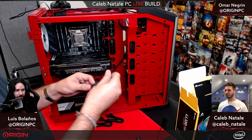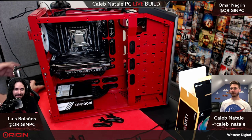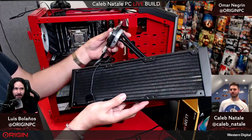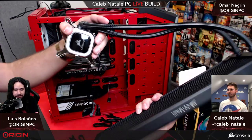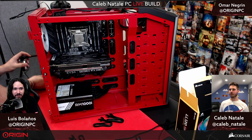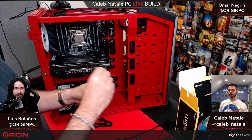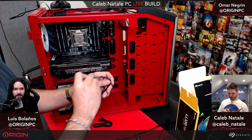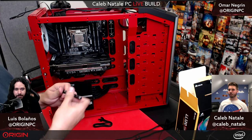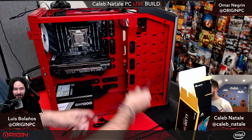So we're using an all-in-one cooling solution, not a custom loop. Custom loops can be scary. And if you're a professional, I know that because we sell professional systems, we don't even offer custom cooling solutions for professionals, because professionals just want something to work all the time. The problem with custom cooling is you have to do yearly or bi-yearly maintenance to make sure it's running smoothly, such as refilling the reservoir. So that's why you're not getting custom cooling to that extent, Caleb. We want you to keep running all the time.